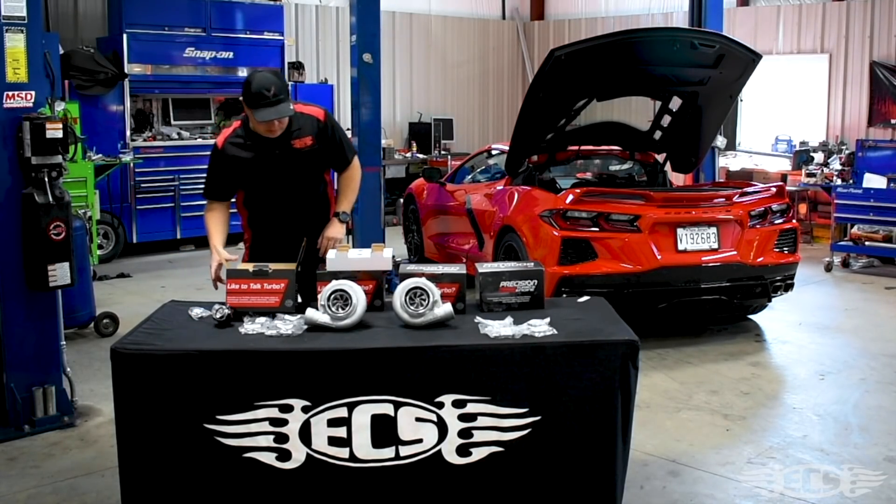What's nice about these from Precision is they come already with the clamps that we're going to need to weld onto our hot side. You simply locate the flange right there, and then the clamp goes over it — same thing for the discharge housing. It makes for a very clean and nice package install. Another thing I like about these turbos is the exhaust housing inlet is on the same side. With mirror image turbos, we're able to keep them symmetrical, keep all the runner lengths the same, keep all the headers relatively the same length, so that we have equal spool time on both sides, which also helps with efficiency.